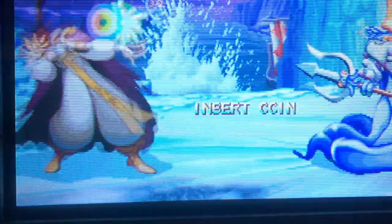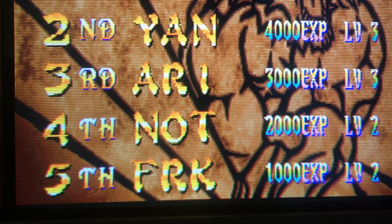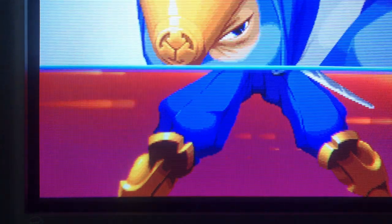I did notice the focus might be off a little bit on this set, and it's a little more tired — it probably could use a white balance adjustment. I'm curious if I did that whether it would come out sharper, or whether the tube being fresher would make it as sharp as the 27. That said, I have an XBR over here — that's a 36, actually 37 inches — and that XBR is just as sharp as the 27, if not more. So I'm inclined to think you're not going to get a sharper tube just by getting a smaller one.